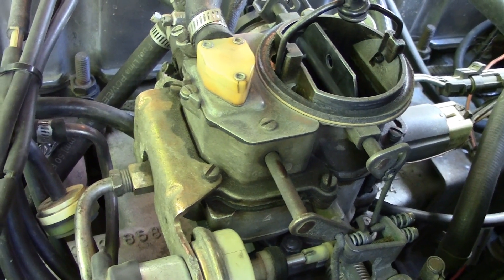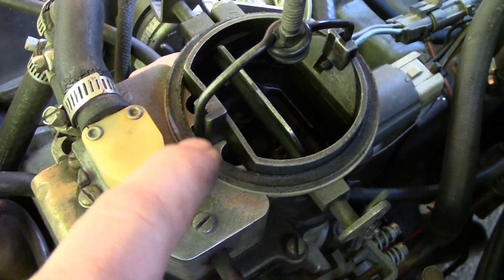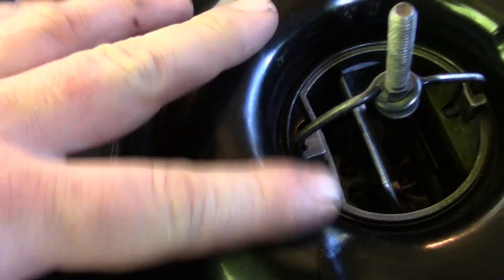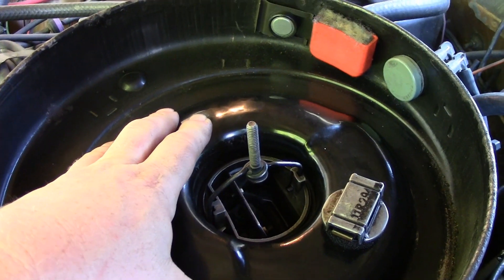It's difficult to say it's a sealed carburetor, but this is not an open-air vented carburetor — even though you can clearly see on the top here there are bowl vents sticking out. That's because the air cleaner is part of this section of the carburetor as well; it's all part of the vapor control system. Vapor can collect inside the air cleaner and go down into the manifold all it wants, as long as it's going around the circuits and keeping vapor out of them. But it can't go down the snorkel and escape to the atmosphere because of this little door here. When the engine's running, the door's open and air can pull in. But once the engine stops, there's no vacuum, and it slams itself shut — so all of your fuel vapor is still trapped inside of here and cannot escape to the atmosphere.